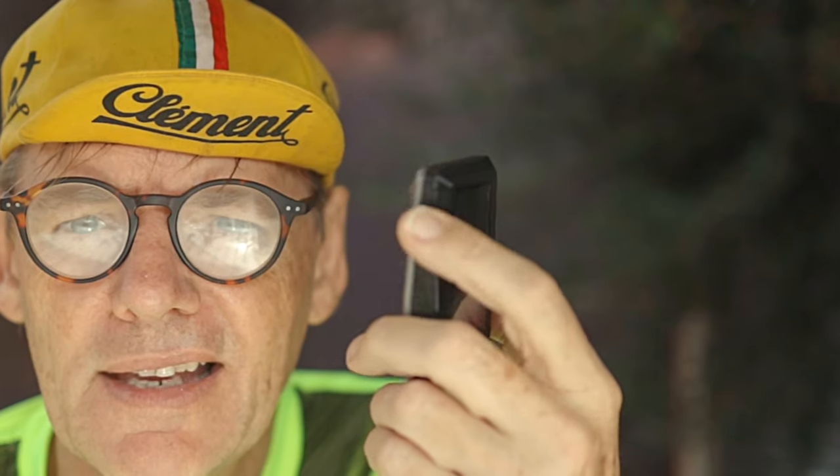The build quality has been very, very good — apart from normal scratches and wear and tear, it works 100% perfectly. The only problem I've seen — not on this particular unit but on the Bolts, and I imagine similarly on Garmins — is this rubber piece used to turn the unit on and off. I've been quite careful and pressed it gently, so mine hasn't broken, but I've seen it broken on other people's units. The trick is not to use your nail — use the soft part of your finger. You have to press a little harder but it doesn't damage the rubber. Once that rubber is broken, the water seal function of the unit is gone. That's the only hardware problem I know of with these Wahoos.